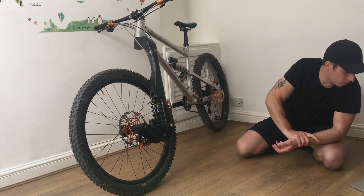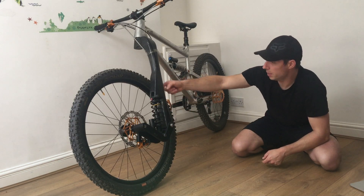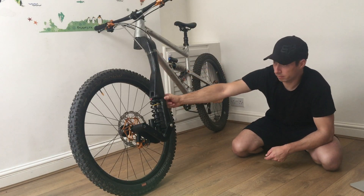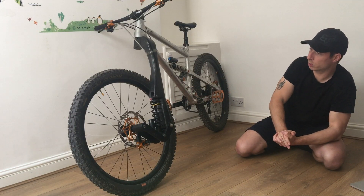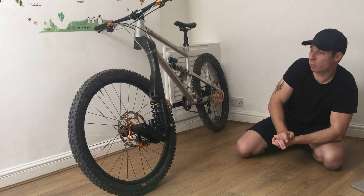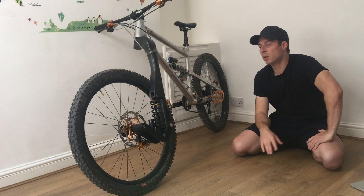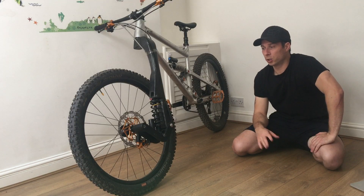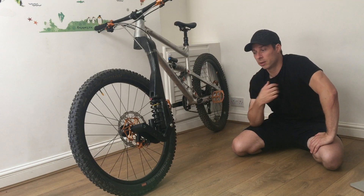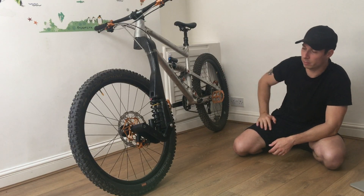And I think that's everything for the upcoming second prototype. I did a few more quality-of-life improvements as well — as you can see, I've got the brake cable held with sellotape here. I could use cable ties, but it's quite close to the wheel and there aren't any brake cable mounts there, so the second version will have those. Basically addressing all the improvements I thought I could make. This first prototype was a bare-bones version — I just wanted to be able to use a rear shock of 230x65 size, use a 200mm rotor, a 20mm through-axle, a 29-inch wheel if I wanted to, and just bolt it onto my fork and frame and ride.